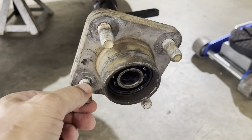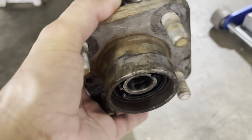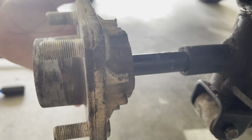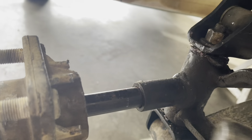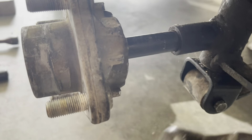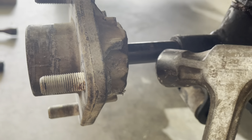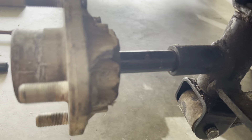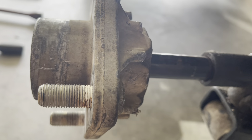So I went to take apart this side. I already replaced the bushing and this hub was bad. I've already knocked it out off the axle — it's ready to come out. In order to get the hub assembly out, all you need is a hammer. I tapped it and rotated it, tapped and rotated, obviously for a long time because it goes all the way up. Just take your time and it'll come off nice and easy. If you rotate it versus trying to whack it in one spot too often, you could bend something and we don't want that.